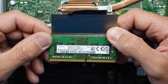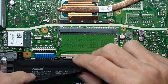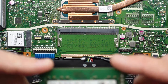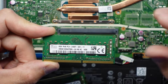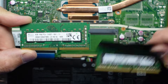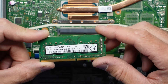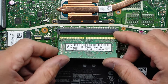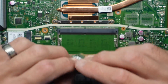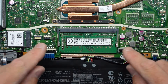I want to change this to probably 12 gig of RAM, as 8 gig is a bit too lackluster. I only have an 8 gig stick of 2400 MHz — I don't reckon the speed difference is going to make a huge amount of difference versus the quantity, since I'll run out of RAM with 8 gig before 12 gig. Installation is straightforward: slide it in at a 45-degree angle and push down to lock in. Push it in, pull down, and we click — we're good.